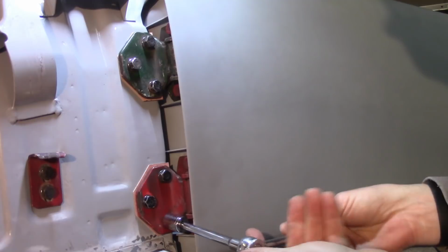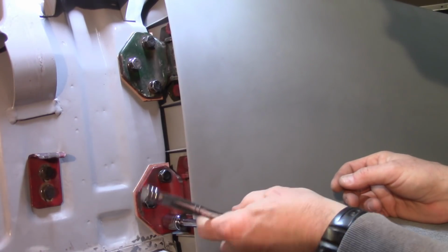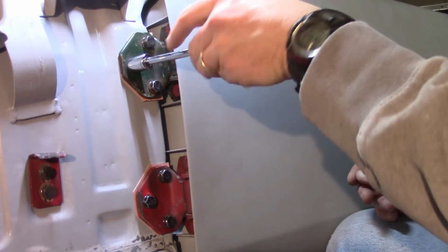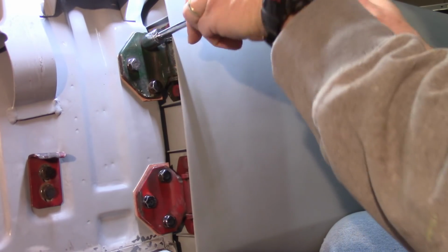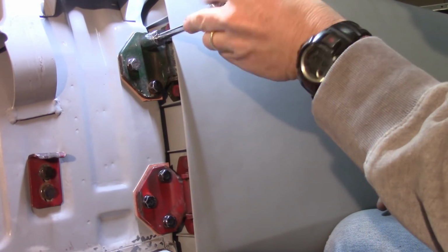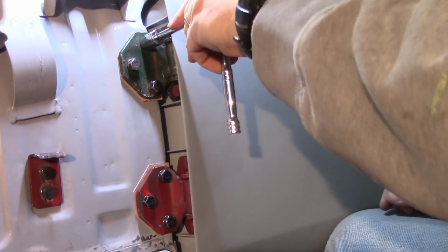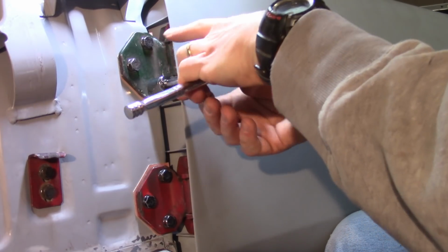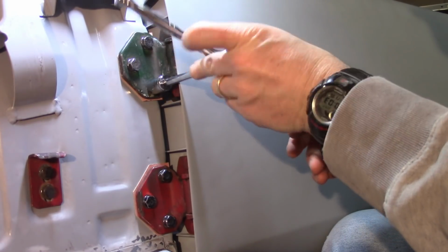Now, again, as I said in the blog, and as I've said on some forum posts and everything, a lot of times you'll tighten up something somewhere, and 8 feet away something moves, especially with that darn bonnet. So tightening these up may cause the door to adjust a little bit as that hinge really comes in with solid contact on the B-post. I don't really see anything moving right now. The door might have come out a little bit at the back, but that's okay because the striker plate should really be the one taking care of that.